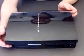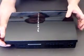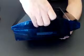The first thing to do is make sure that you have disconnected it from the mains and switched it off. Then we start on this side where you'll find a little security screw, which is ordinarily under a warranty sticker. I've removed the warranty sticker because I've had this machine open before. You have to remove your warranty sticker — obviously don't do that if the machine is still under warranty, send it off to Sony. Under the warranty sticker you'll find this little rubber security screw cover, or rubber foot some people call it, and you just need to pull that out. Get your fingernails on it and it comes out.